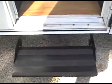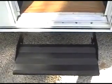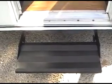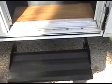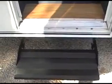I had to do quite a bit of work wiring-wise on it. And if you can see right here, of course, this is the door sensor that senses the door open, and it opens it and closes it. I sandblasted all of that, refinished it, and then of course came across with the anti-slip tape across the top of the steps. So that works real nice.